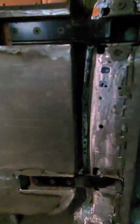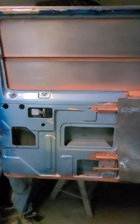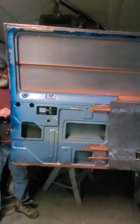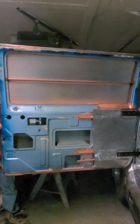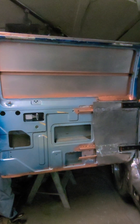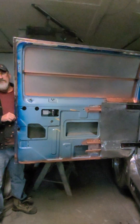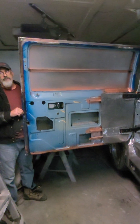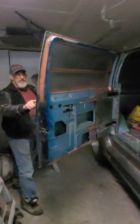There's an 18-gauge plate on top and all the way around so we could cover at least four holes — holes for wiring, for the striker, for the slider, all that kind of stuff. I took care of it all in one stroke with one piece. Now we're going to extend the bottom so it's easier to do the trim work on the interior, and that's it. Watch the one-finger close.